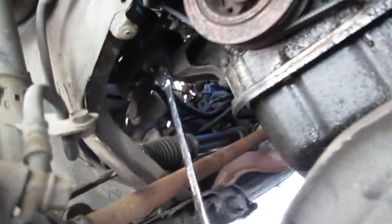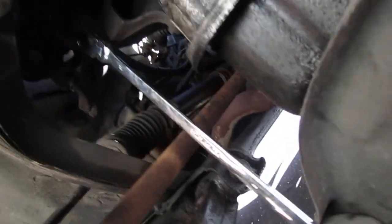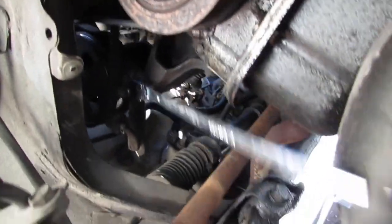These bolts here, we're going to pull off that one here, and then there's another one right here, and another one all the way underneath, up front. So we can pull those down and then drop the splash guard out. Right here, we've got to get that 12. Yeah, that's a 14 mil. So you can crack that loose, like that.